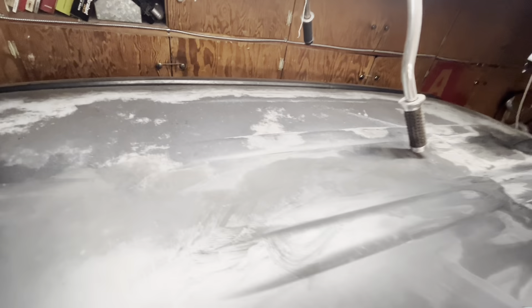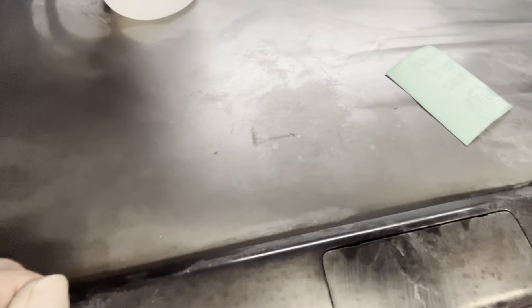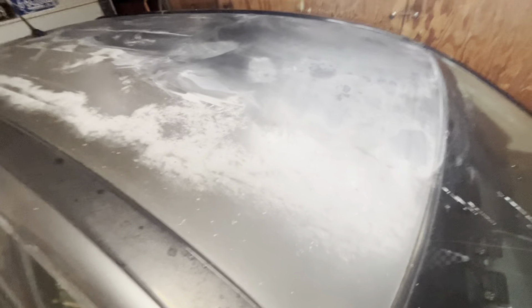I've been starting to knock the oxidization loose. This is definitely a before, and this is an after. I've been using a block sander with 800 grit and little pieces of 2000 grit with a spray bottle of water. It's starting to knock it loose, but I noticed I'm getting a couple of burn holes in it. So I think what I'm going to try next is a cutting fluid with a towel to remove the rest of the oxidization, because I think it's going to show through the clear coat still.